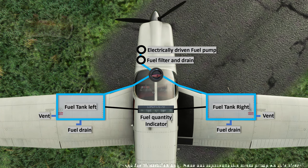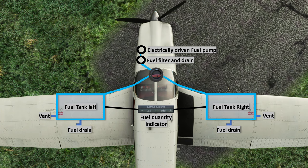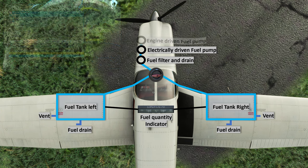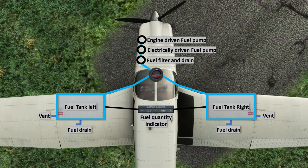Next in line is the electrically driven fuel pump, also called the auxiliary fuel pump because it is used as a backup. Its function is to provide pressurized fuel to the fuel injectors when the primary pump malfunctions. Another function is to prime the engine — meaning directly injecting fuel into the cylinders during very cold weather to assist engine start. The supply line then connects to the engine-driven fuel pump further downstream, which is the primary fuel pump that always stays on to deliver fuel to the engine in every phase of flight. The auxiliary electric pump stays on only for takeoffs and landings on normal flights. I'll link a video in the description that goes over the working of engine-driven fuel pumps in detail.